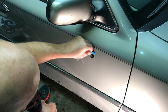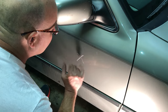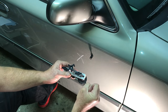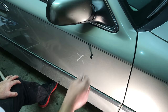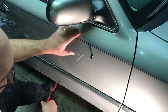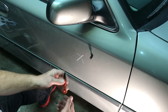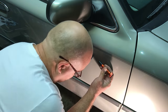We're now going to remove the glue. Start at the top, let that alcohol work its way in behind that rubber. That dent is still there — yes, it did pull it up. There's a tiny little dent right in the center. For this tool, we found that it works good on pulling the main part of the dent out, but you'll always end up having to go back to the slide hammer. We're going to let that set up. Since I've gotten it down to the point where I can pull the dent right out almost perfectly flush, I'm not getting the chance to share with you how to use your knockdown tool.